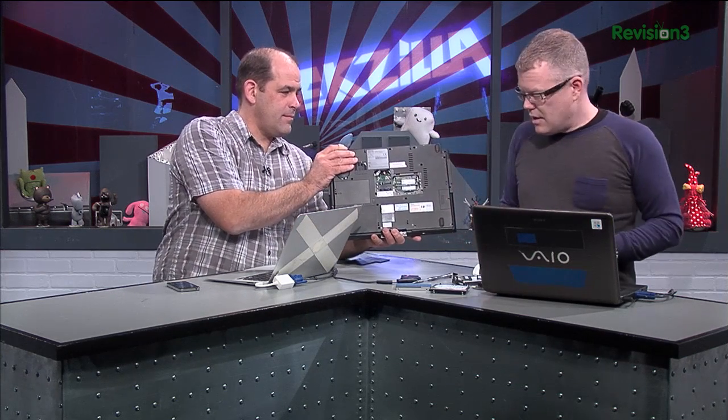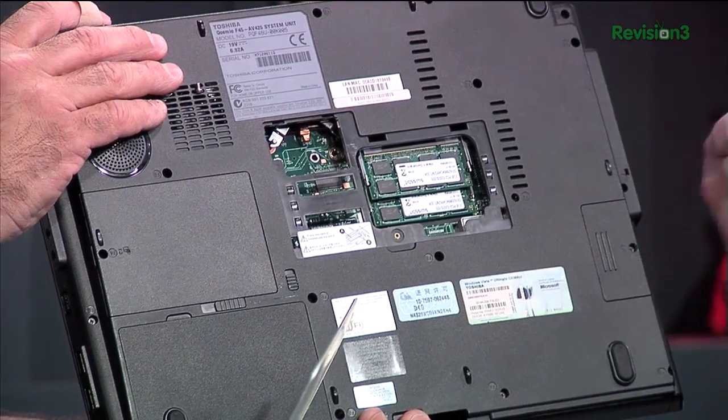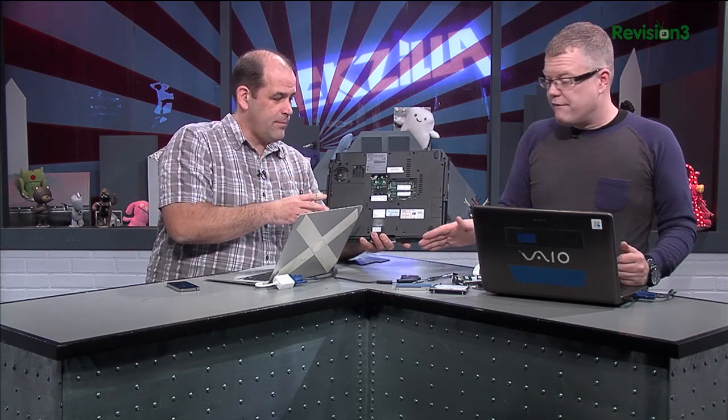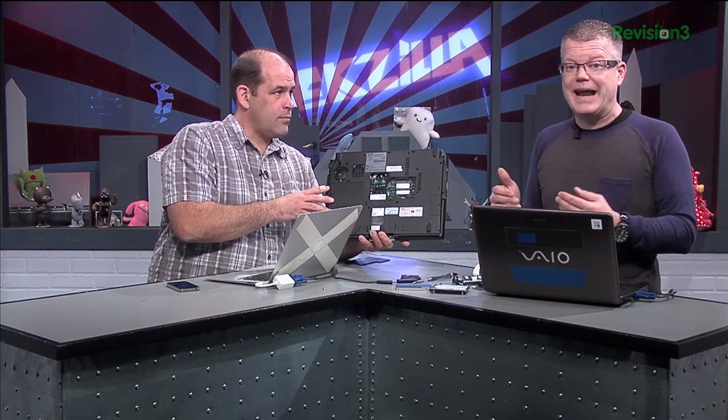When we're talking memory, similar to your desktop computer, you want a matched pair for a notebook if you're going to go with two sticks. If you pop open your notebook and find in the access port on the bottom side where your memory is located — if you find you only have one stick, that would be one way to upgrade. You could just see what type it is, order that same one, and grab another one. A lot of memory manufacturers actually have a guide that'll help you. You look up the name and the model number and it'll tell you whether it can take one stick or two sticks, and how much memory it'll max out at. That can be super helpful. For older notebooks, I find they're pretty conservative about how much memory will fit — they'll usually limit it to about a gigabyte.